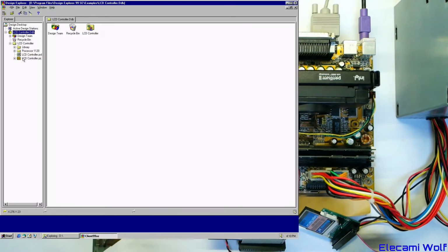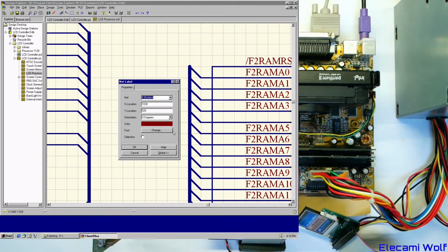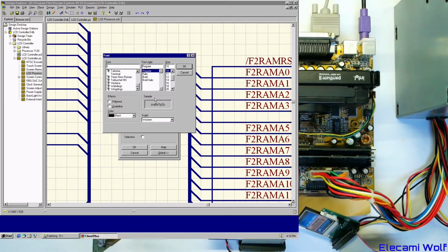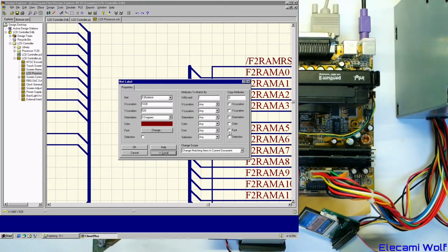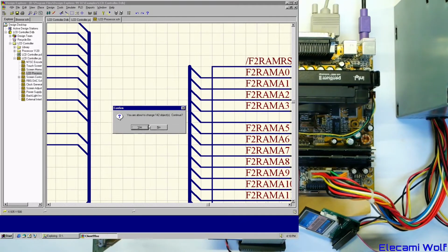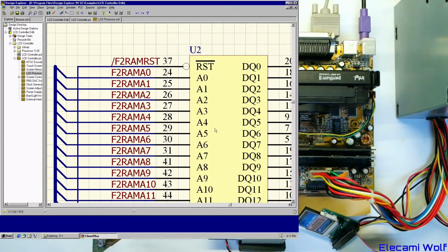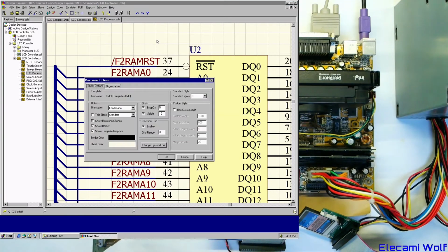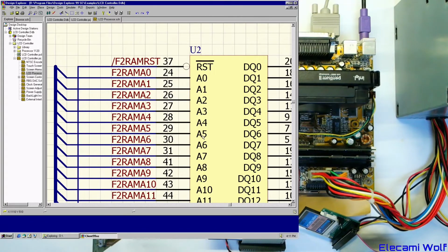If it works enough, then we might be able to just carry on as is. Seems like it does. Ugly fonts that it has by default. You gotta change that to something that doesn't look disgusting. ProTel really likes ugly fonts. There you go, look at that. Better. Except you got to do that for all object types because the way the global thing works in ProTel is not so flexible as it is in Altium. See, that will fix those.